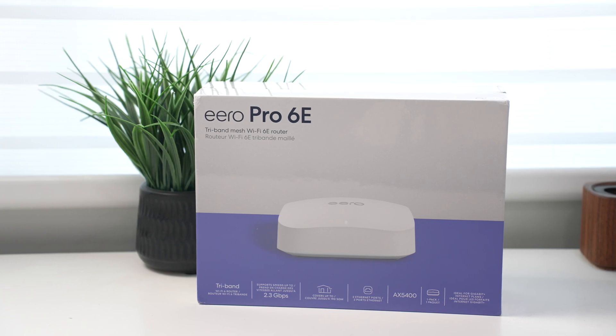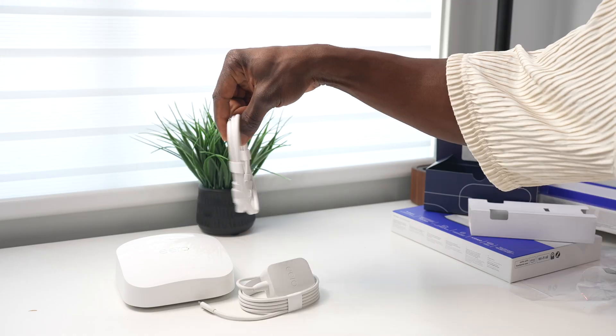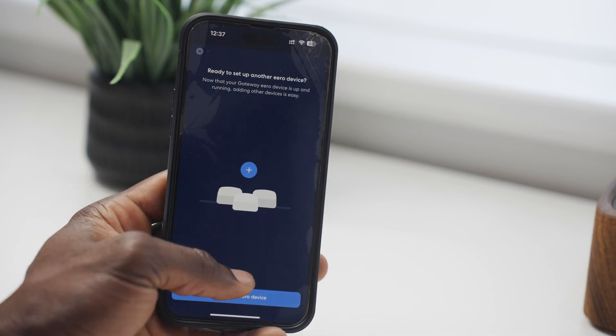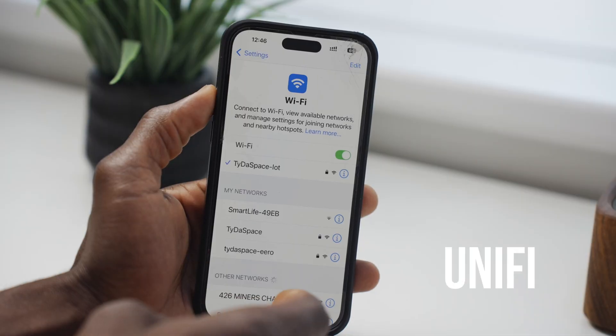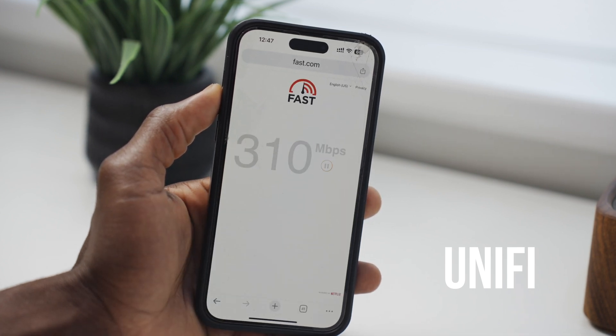With the Amazon Eero, you get a quick 5-minute setup using the Eero app — it took me all of 5 minutes to get it fully set up. With the UniFi system, you have to configure VLANs, SSIDs, QoS settings, firewall rules, and a whole bunch of advanced features to really take advantage of the system. The one big thing that separates both of them is setup and ease of use. The Eero is very simple and can be used in pretty much any part of your house, whereas the UniFi system probably needs a rack or some dedicated area.